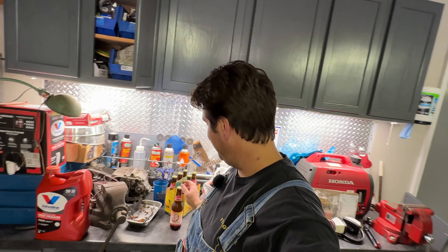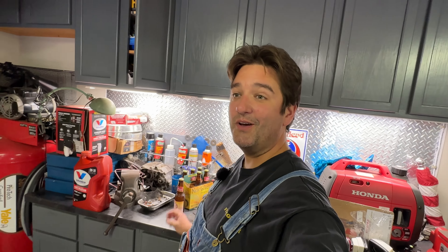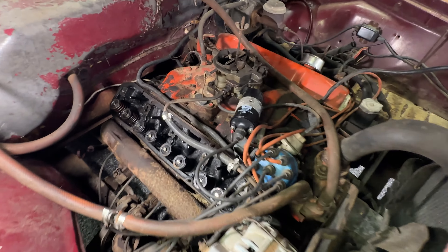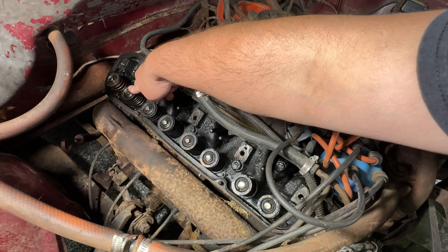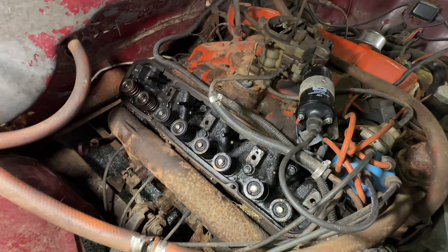Jojo's Loaner Tool program actually pays off — my neighbor had to borrow some thread chasers, so as a thank you he dropped off some good old-fashioned Wisconsin beer. Glad to help where I can. These old valves, they're not looking the best. We're going to try the Harbor Freight spring compressor, see if we can grab that spring and retainer back off of there, and then we'll get to heating that guide up.